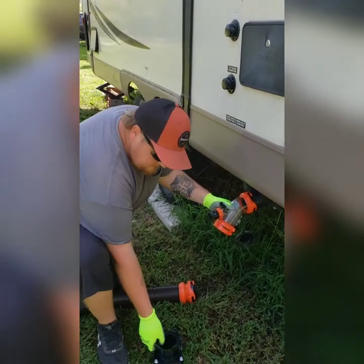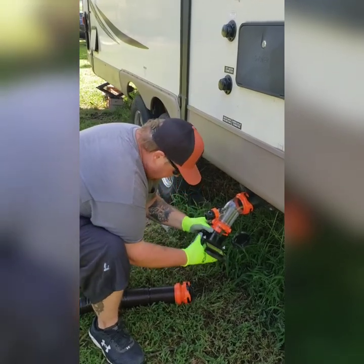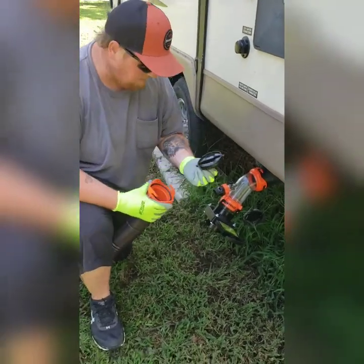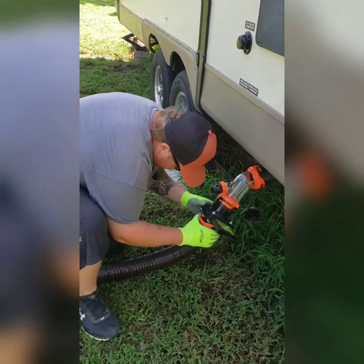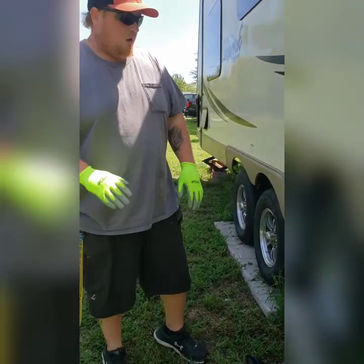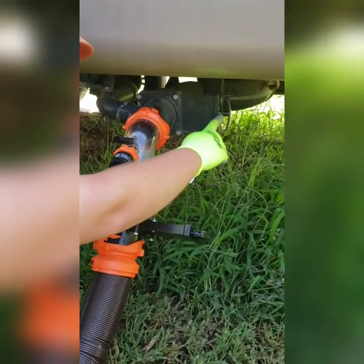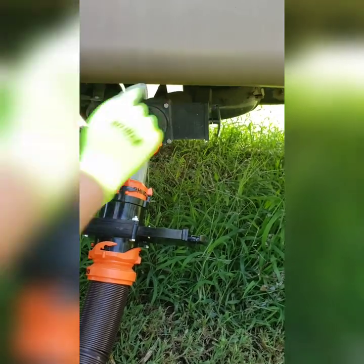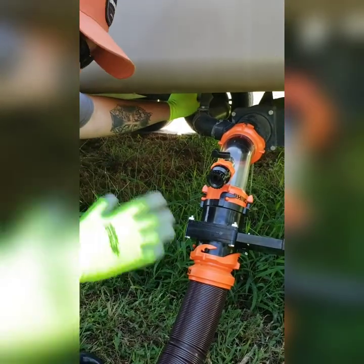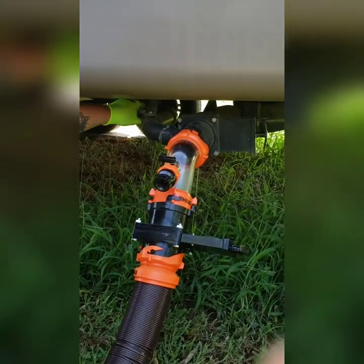So this snaps into here, and then I have another on-and-off valve that's going to snap in there. Then you take your cap off and that snaps in just like that. This handle that is black is your black water — your black water is your sewage and waste. Over here is your gray water valve — that's all your shower and your sink, the cleaner of your disposable water. You always want to dump your black water first, and then dump your gray, because that kind of cleans everything out.